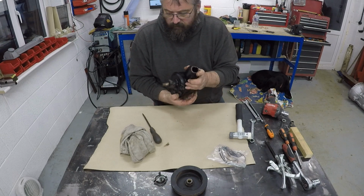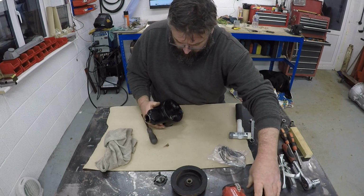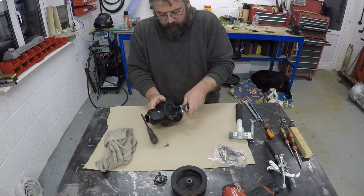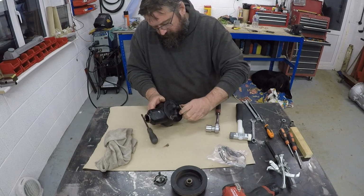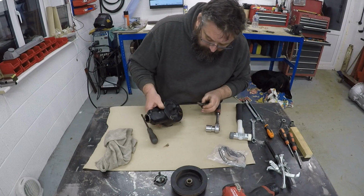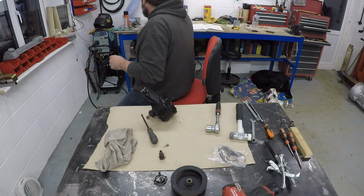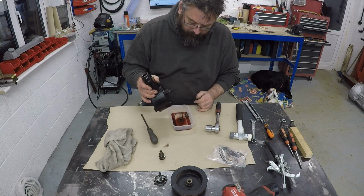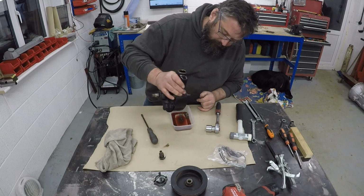I think the way the pump comes apart is this couple of bolts on the back of it, screws, and then this I think should come out complete with a pressure valve. I'll start with that. Oh, only hand tight, so that's always a bit worrying. So I'm pretty sure that should be a little bit tighter than that. Okay, so we have a spring and a piston of some sort in there, and we also have more fluid. So let's tip and see what comes out. Right, there we go. So we have a spring and a piston and some rather manky looking old power steering fluid.